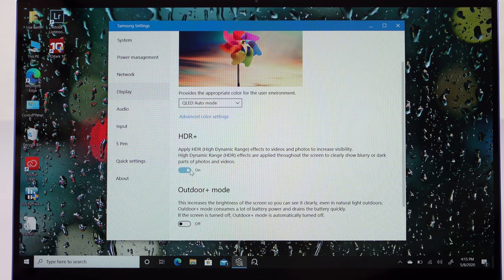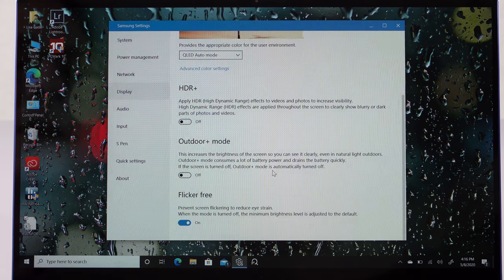There's professional mode, which is pretty much your Adobe RGB mode for folks who are doing professional photo editing or content creation, and a variety of others including your base sRGB. There's also a PWM switch — pulse width modulation — so that's the backlight that cycles and some people are sensitive to it. By default, the control for that is turned on, which means you won't see PWM because it's only refreshing at such a high rate that the human eye won't pick it up. It won't get quite as dark when you're setting the brightness down when that's active, but it gets plenty dim enough anyway.